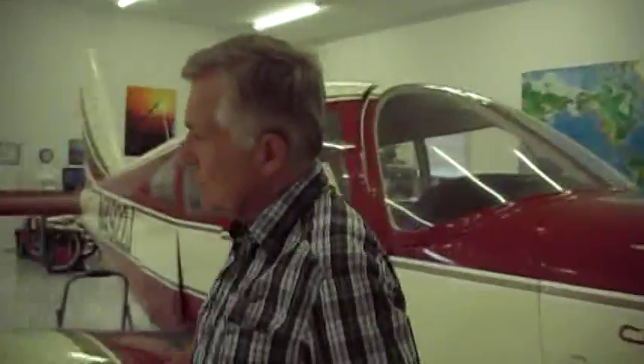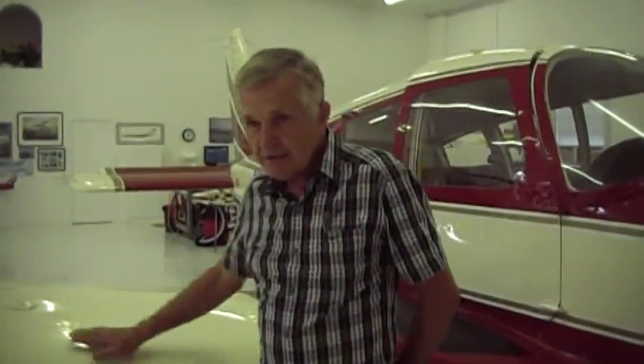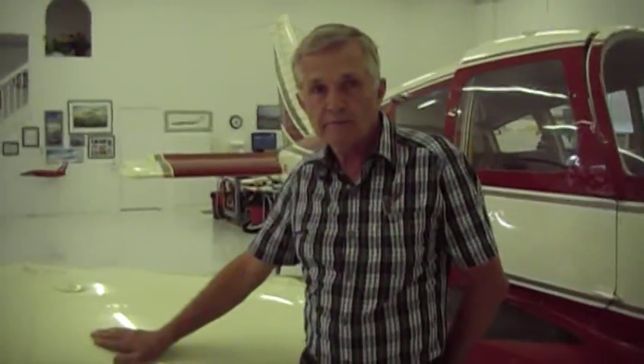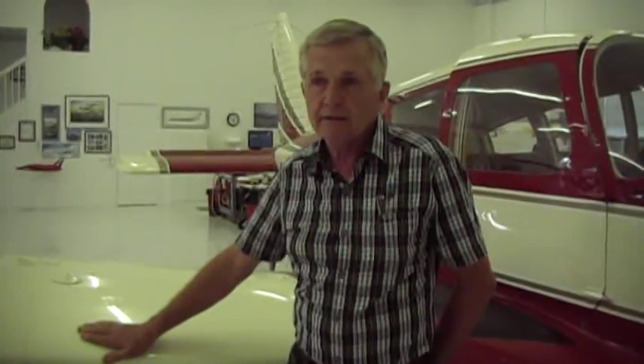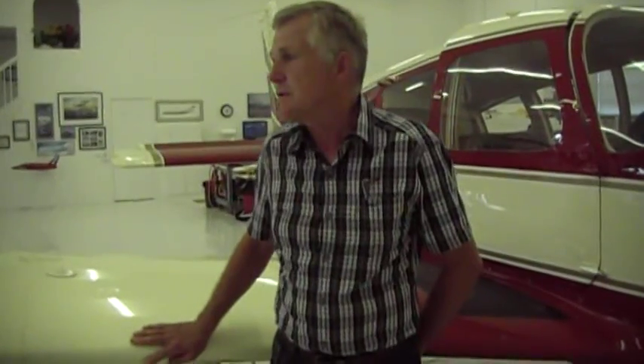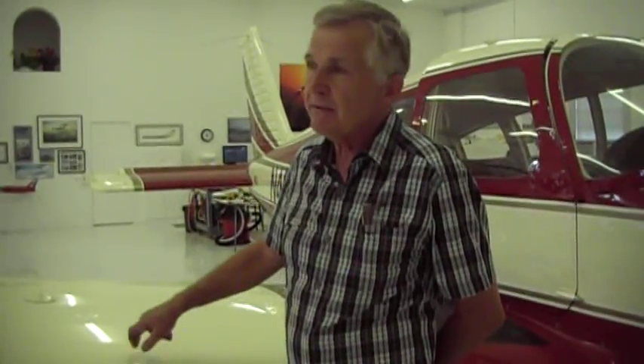You can see the result of what happened in terms of the finish of the aircraft. What was once extremely chalky paint now has a gloss back, and more so the aircraft is glass smooth. I ran the closed course again between where I'm located and Sebring, Florida, simulating the conditions I initially flew it in to see if there was any speed change. I picked up in the neighborhood of just under three knots on the closed course. That proved to me that even though I only added less than two pounds, something about the product picked up the speed of the airplane.